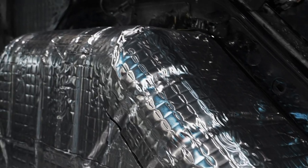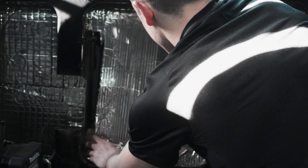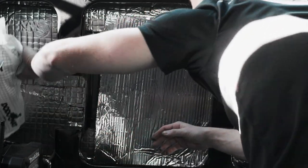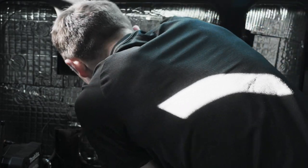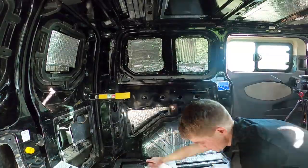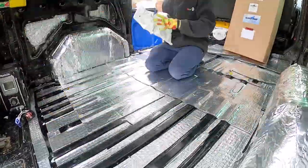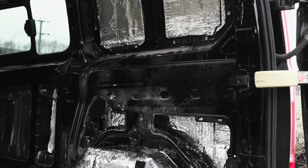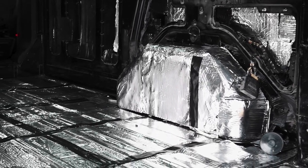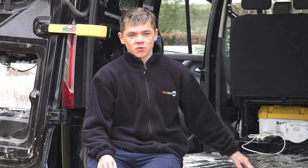Okay, soundproofing is now done. Now it's time for the insulation layer which just goes on top - another sticky back so I'm just going to be cutting out and sticking again. It's not a tricky job at all, it just takes forever. I feel sorry for people who have a bigger van than this. Okay, I've gone over all the soundproofing with the insulation so it should be nice and toasty now. This only took about half a day and the soundproofing took about a full day. That's this phase complete - the boring bit. Now onto the fun bit, which should be the carpeting.